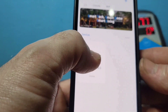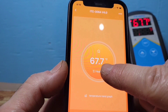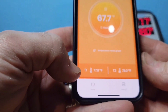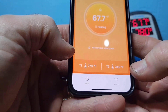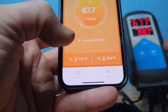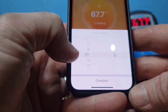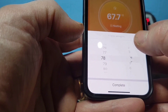If you click on the device, you can see the current temperature — it's reading 67.7°F, which is correct. T1 is the minimum temperature set at 77°F and T2 is the maximum at 78°F. However, connecting the app can wipe your previous settings, so you'll need to reset them. Press the lower temperature setting and set it to 78°F — you can also add a decimal if needed.